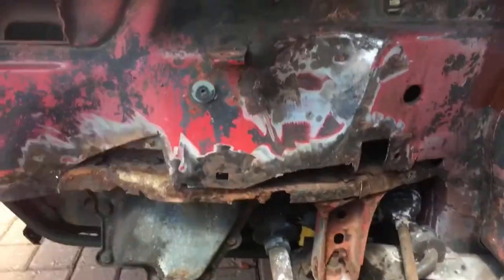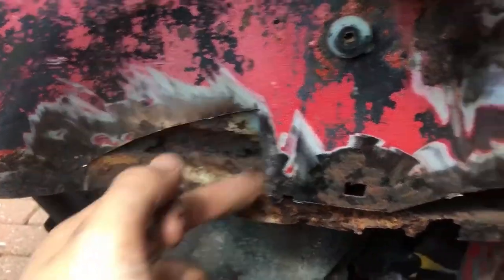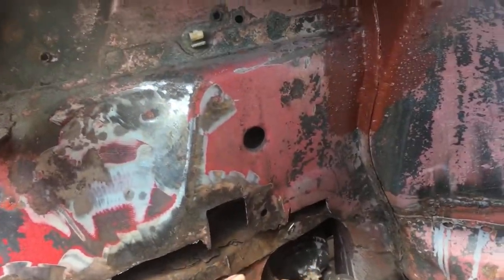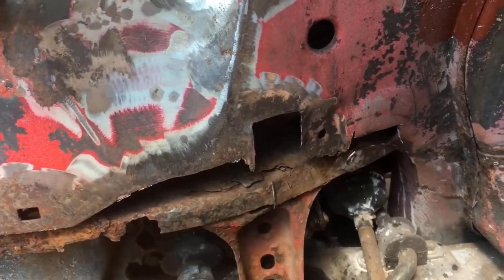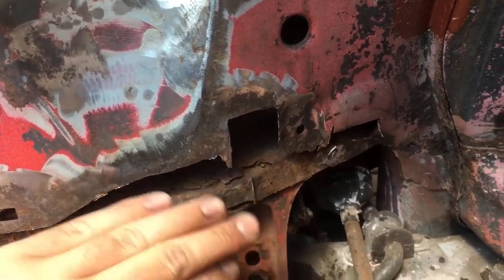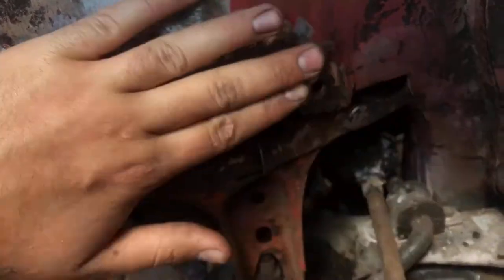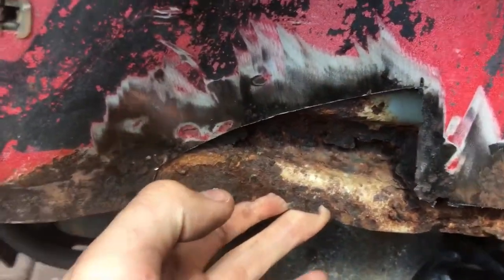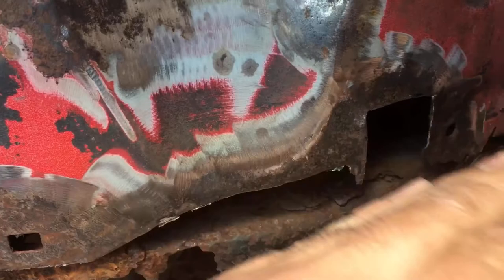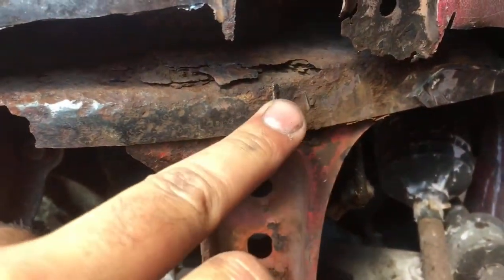So we've got big problems here. I've chopped this bit out back to fresh metal, and the rest of it out to fresh metal apart from here and here. I've left that little snag end in so that it can keep our shape — there's a raised bit there. So I've cut round the raised bit and I'll put a fresh piece of steel in there.